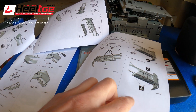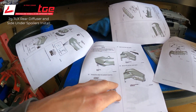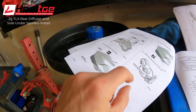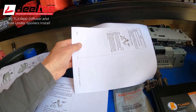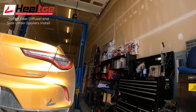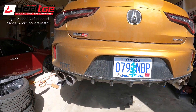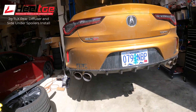Put the little captive zip tie tails through the back side of the bumper - that should be basically the same for both. Use the supplied hardware to install it - zip ties, tape. So really all we need to do is get the bumper off, find the scribe marks, drill some holes, clean the bumper - mine is really pretty nasty so I'll hit that with some cleaning agent first - and then find those scribe marks, make some holes, and there you go.